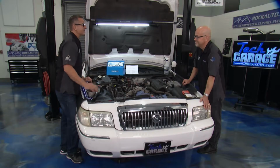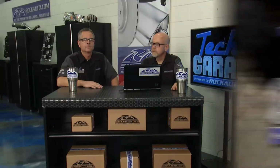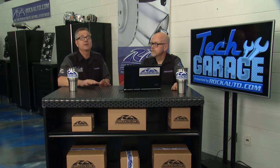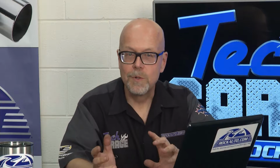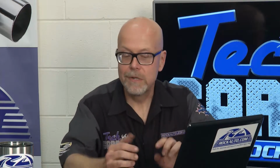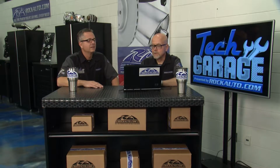Perfect, let's walk over and check it out. Great. Well, you saw how important the accessory belt drive system is and the kit we installed in there. What about timing belts? Do you have kits for that as well? We do, and the timing belt can be even more important than the serpentine belt because it's so buried in the engine. You don't want to do that labor again, and if it breaks, you can have a catastrophic engine failure.